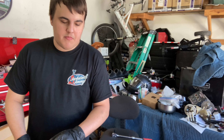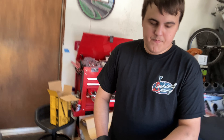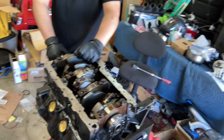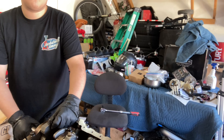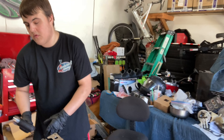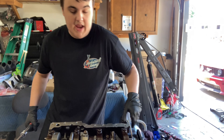I'm skeptical of a piston ring not being where it should be, being pinched somewhere. Davis is a little skeptical of the bearings I bought, just to explain - this crank got polished, so material was removed from it. Then he has oversized bearings to make up the difference. I'm thinking maybe those oversized bearings are too big, and that's what's causing the resistance inside. Either way, we're going to pop all the pistons out, see how it turns over with nothing in it, one at a time. See if there are any ring issues. That's our next course of action - we can't let this go on like this.